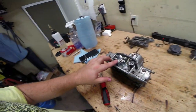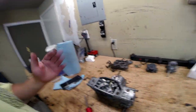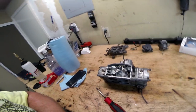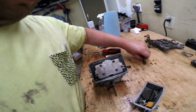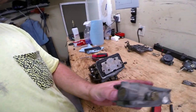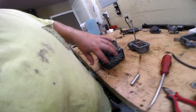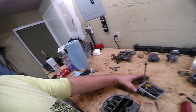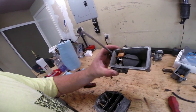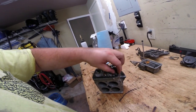The AP has these three screws that hold it on — you can see them right there — and once you remove them you can just pull it off the body, there's nothing else attaching it. If you take out the four long screws on the non-metering block side, they each have a little cloth crush washer on them. Then this part just slips out and this is your float. Next we take off these four longer bolts. This bowl, and we can remove this little gasket that sticks on these nubs.